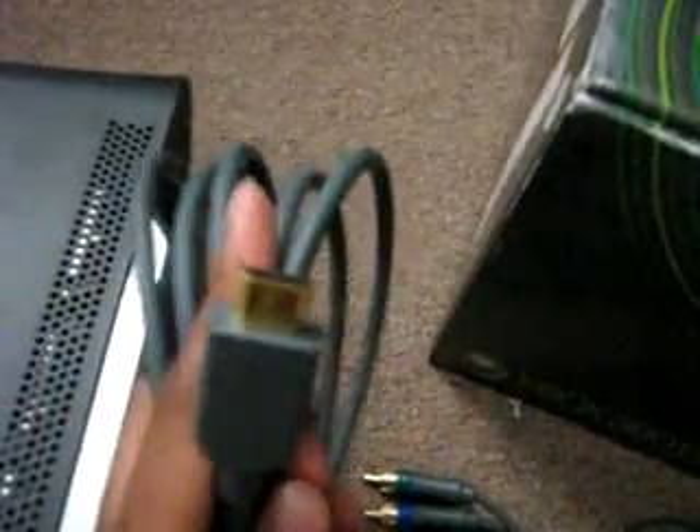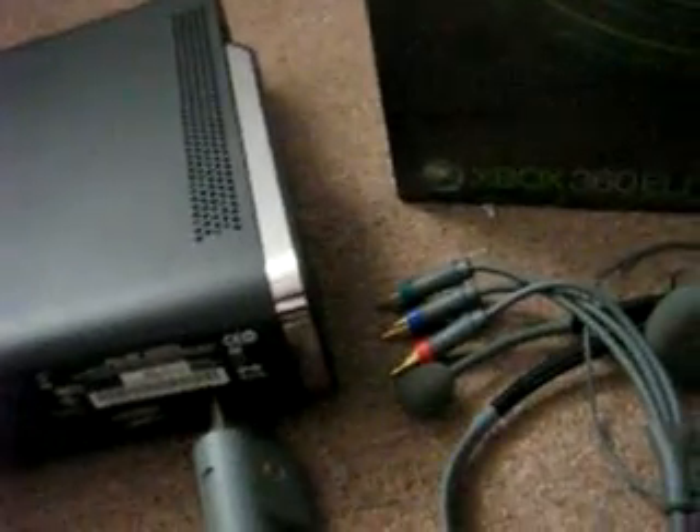It can provide close to 1080p, but if you want true 1080p you'll need something like the Xbox 360 HDMI cable, which provides audio and video through a single cable. The HDMI port is right here. Unfortunately, the Xbox 360 Elite only has HDMI 1.2 specifications — it doesn't support Dolby TrueHD, which is part of the HDMI 1.3 spec. It only supports Dolby Digital surround sound.